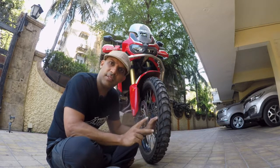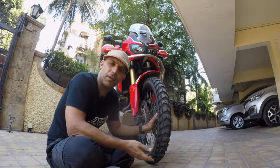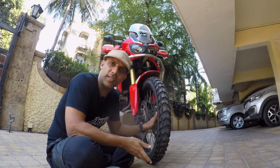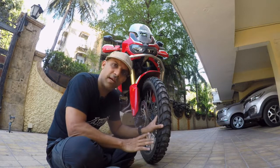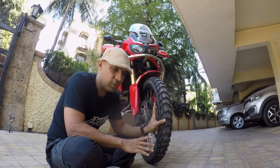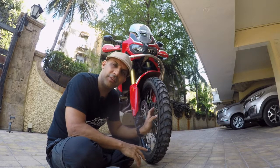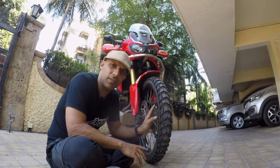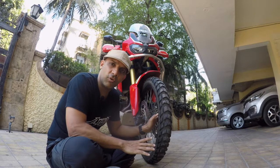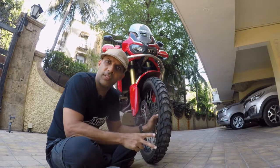There are people who say don't go Outex because Honda gives spoke wheels so you can reduce tire pressure really low for off-road. That's true — they do — but even with my Outex I've taken pressure as low as 18–20 PSI with no problem, because modern dual-sport tires have very thick sidewalls and don't come off the rim easily. If you're going down to 17–18 PSI, just go easy and avoid very rocky terrain at speed, because rocks can bend your rim and then you'd need a tube.